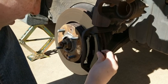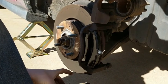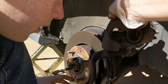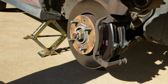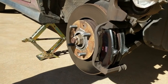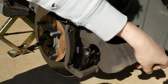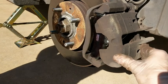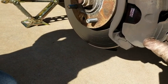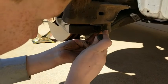Here's how you slot in the new brakes. If you push the piston in enough, this should be a snug fit when you close the calipers. If the bolt doesn't seem to be grabbing the thread, then it's not lined up correctly.